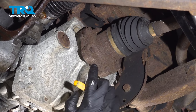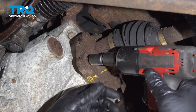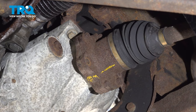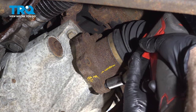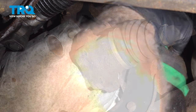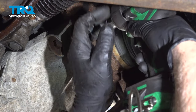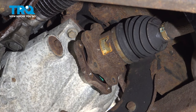I'm going to take these bolts out of the axle. Before we do that, I'm just going to mark this so we can put it back together the same way it came apart. Using a 15 millimeter socket, take these bolts out and separate that. We're going to do the same on the other side.